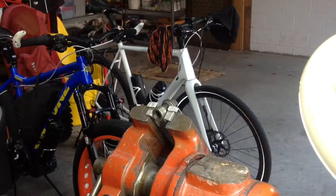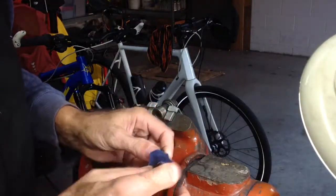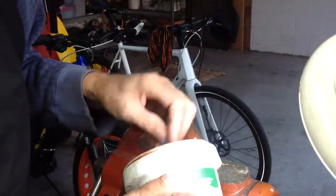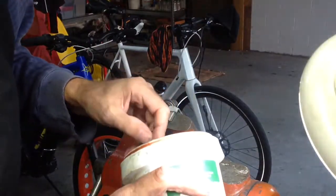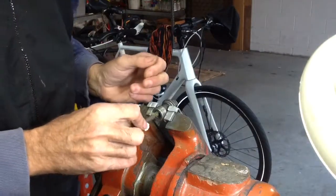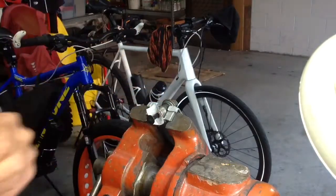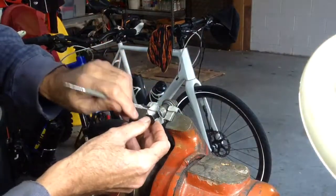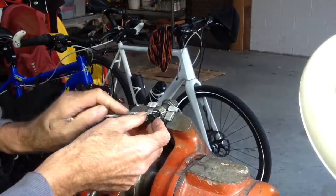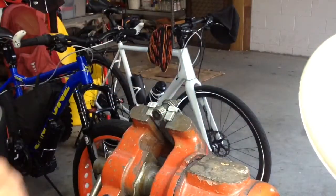My main concern here is that if I get any valve grinding paste in there, I can grind it away and I don't think I can get those O-rings anymore. I will check, but if I can't get those O-rings, I can't take that O-ring off without probably breaking it. It still sort of seals at the moment so I've got to leave it. So a bit of grease there, push it in. That cloth there was just so that I poked the cloth in there — the idea is that any valve grinding paste on the outside won't make it through to the end there where it goes up and down the side of the shaft.